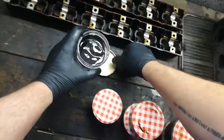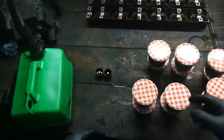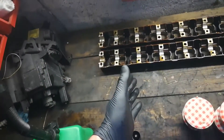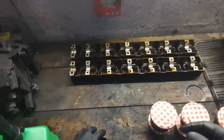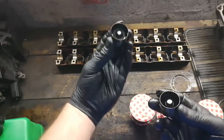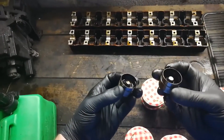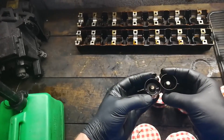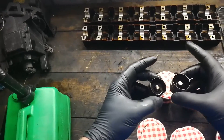The main reason I'm using E46 lifters: first, the cam trays are slightly better - you can see the areas where the actual cams run are beautiful and smooth with very little scoring. Second, the intake camshaft I'm going to be using came from these trays originally. Third, on my 323 I had two different types of lifter - one on the right is an older design. Dimensionally the same and they perform the same function, but if they updated the design then the newer one is likely better, so I've elected to use E46 ones.